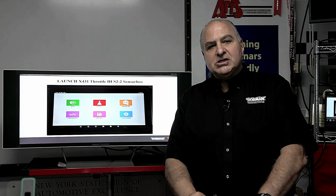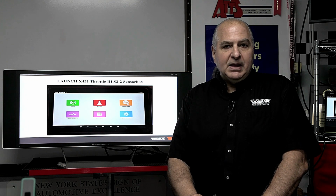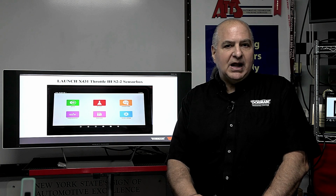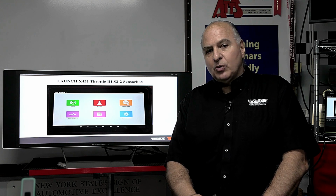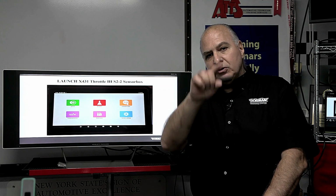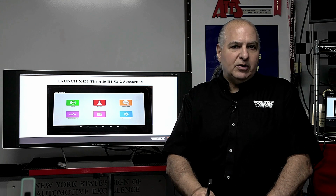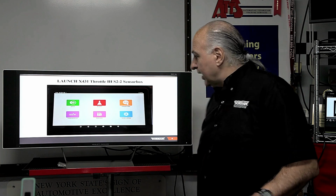What that is, there may be a signal that comes out down the road that maybe is not in there. You could draw any signal you want as an output. So we can draw an ignition signal, we can draw a square wave, we can change the amplitude, the voltage height, we can make an AC signal, anything you want to do in case it's not in the menu, okay?